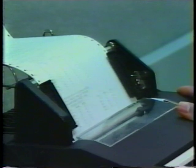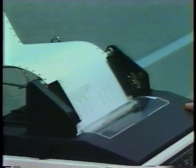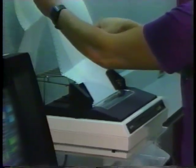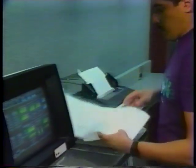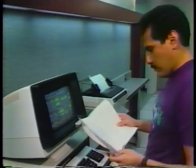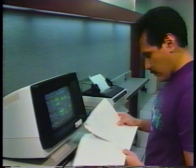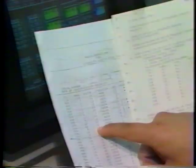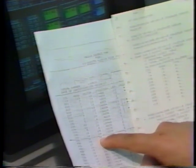Once all of the drives are restored, obtain a printout of the defect table listing from the ROP. This message resembles the original defect table stored inside the new drive unit. When the printout is completed, remove it from the ROP and compare the printout with the second copy of the original defect table. If there is any discrepancy between the documents, the new drive unit may have been defective. If so, repeat the entire procedure.